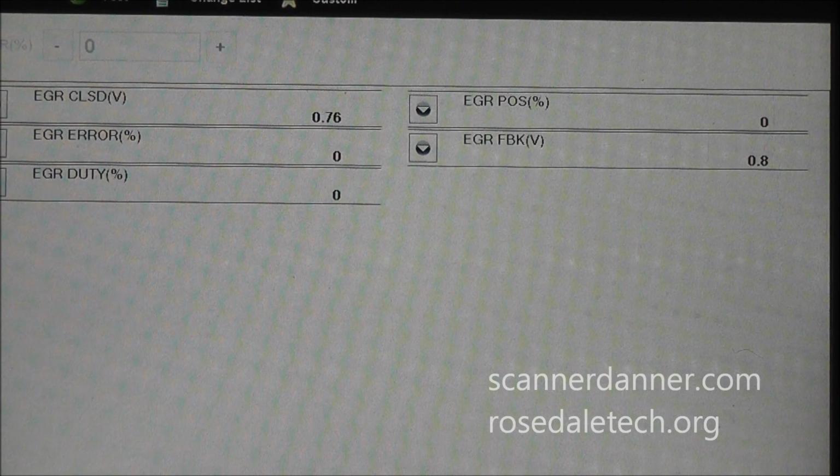In fact, I have a case study on this in my book in section 20, idle air control systems or idle speed controls. I can't remember which page, you guys that have it can refer to it. This vehicle had an 1800 RPM idle speed from this exact same scenario; the battery simply needed to be disconnected to bring that idle speed back down to a normal range. And it was from the same kind of thing. So this is a memory.